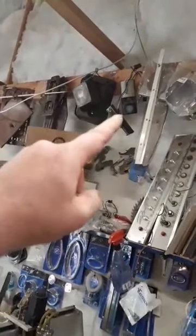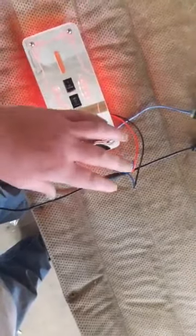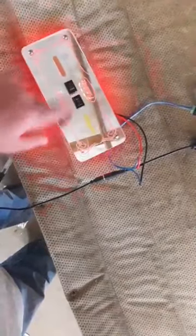Now let's take a journey. This is an old FLD interior out of my FLD that I restored. As you can see it did have map lights — those ones, which are the exact same as late 80s early 90s Pete 379, the same bolt pattern. But for instance it's already got this hole cut out. Here's our slim line and it just has two wires that come out. I can go ahead and put four holes and mount that right in there, no problem. And that takes away from that old clutter. That's the slim line — ceiling glow with the rocker switches, white and red.